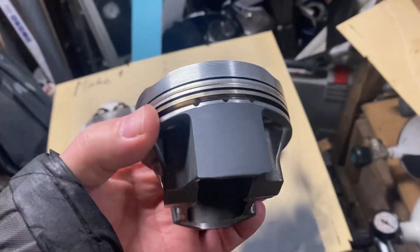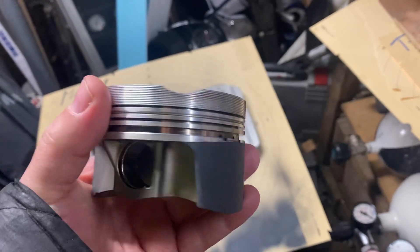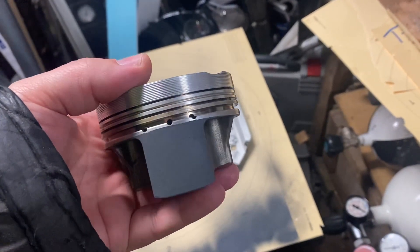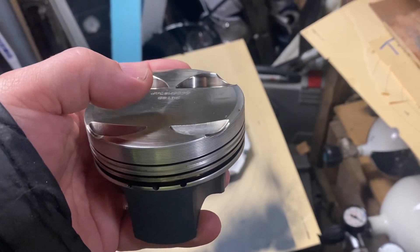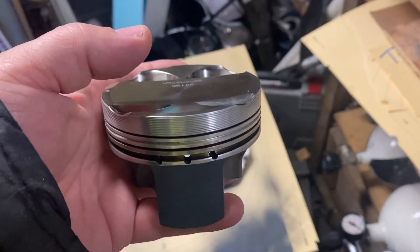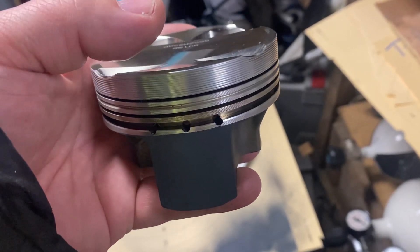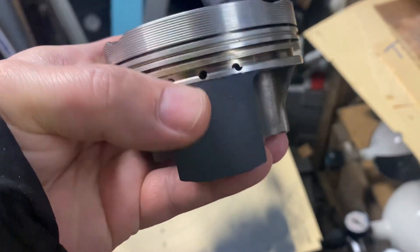The pistons are sprayed with the coating and then oven cured at 150 to 175 degrees Celsius for one hour — and that is one hour from the point that the pistons reach the oven temperature, so that was something like one and a half hours total. It doesn't hurt to be in the oven too long rather than too little time.